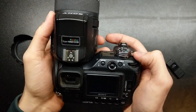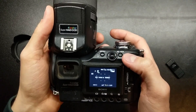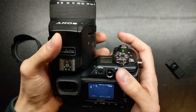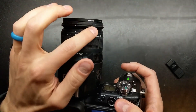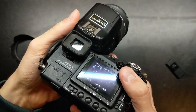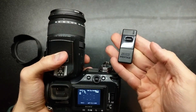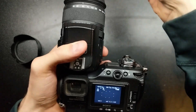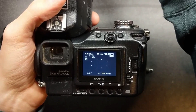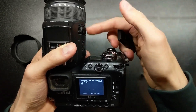Let me show you how this works because it is just too cool — come geek out with me. I'm going to turn the camera on first — it makes cool noises, sounds like a video game. Right now you don't see very much because I have the infrared 720 nanometer filter on, so it's filtering out most visible light. As I move it around the room you're not really seeing much. I have here for demonstration purposes an infrared remote, and if I put this in front of the lens you'll see a little blip — because no hot mirror is perfect, it lets in some IR. But it's not showing a lot, so we're going to move that hot mirror out of the way.